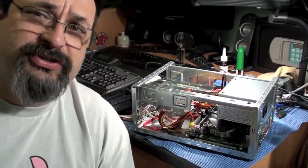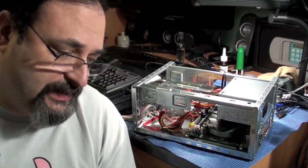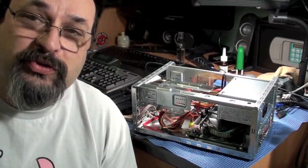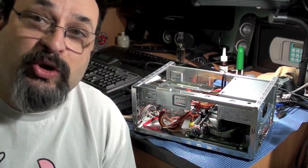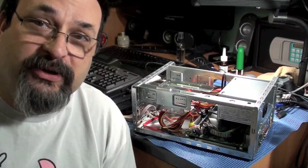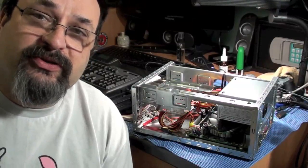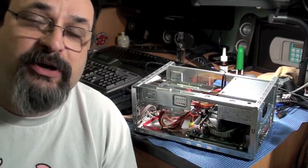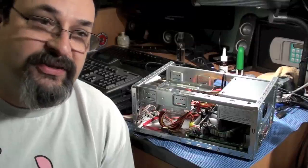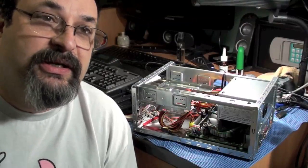Some rules to stick by when trying to figure out what kind of RAM to put in your machine is to go to the manufacturer of your computer's website and look up what RAM is compatible in your machine. Now, if you have a slot open and there's some RAM in there, the best thing to do is to match up exactly the same RAM that's in there. It's good to have everything the same speed, same make. Usually you come out the best.